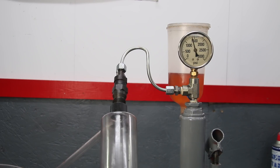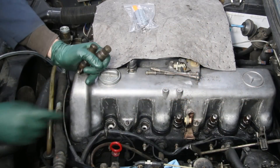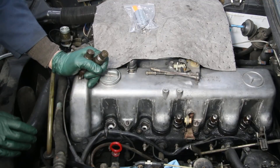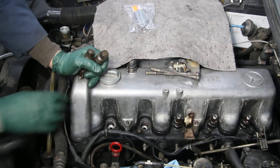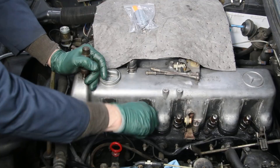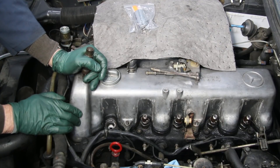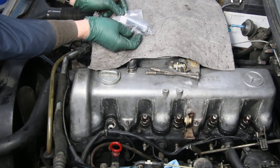You can probably imagine why I'm so excited — I just avoided some extra work rebuilding these, so they can go right back in the engine. I've just completed the ultimate physical health exam and this engine comes out with an A — it passes with flying colors. When reinstalling the fuel injectors, be sure and use the new heat shield washers, which we include in the physical exam kit. Use a torque wrench — we include the correct fuel injector socket in the kit.